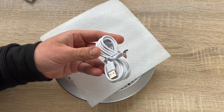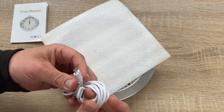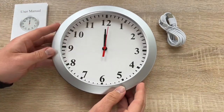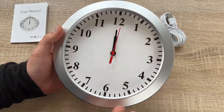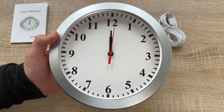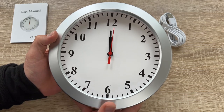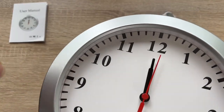For motion detection recording mode, after inserting the card, we turn the switch to the M position. The camera enters motion detection mode — once movement is detected, the camera will automatically start recording. To save and turn off, switch to off. We connect the micro SD card to our computer's USB port to view the folder with video and time.